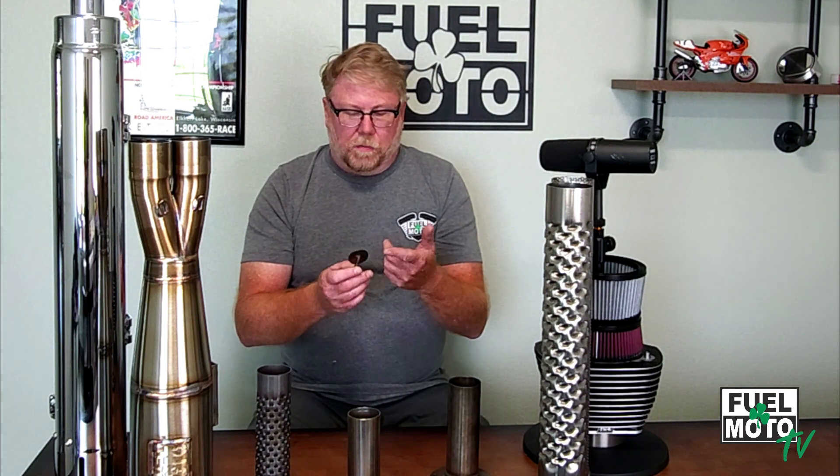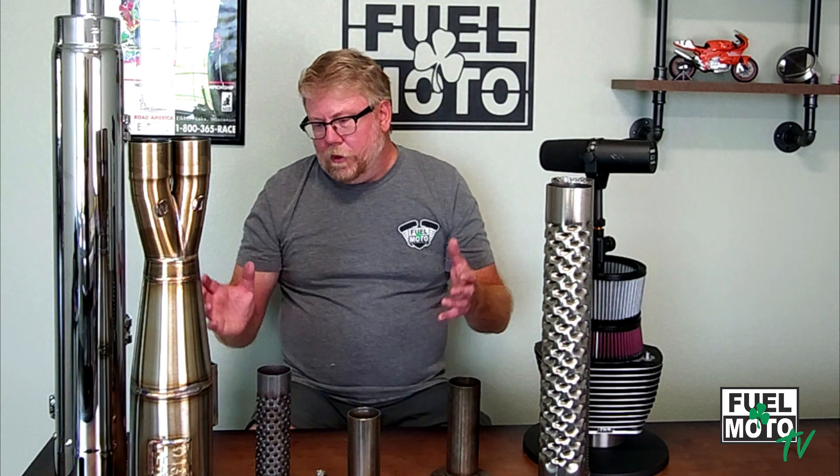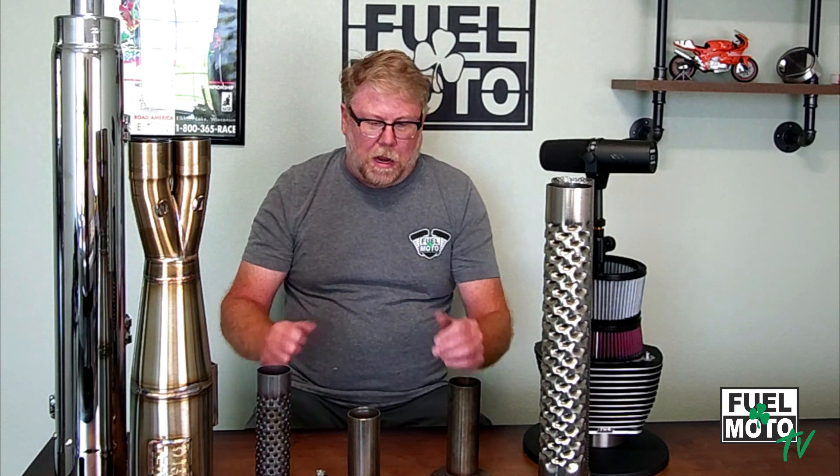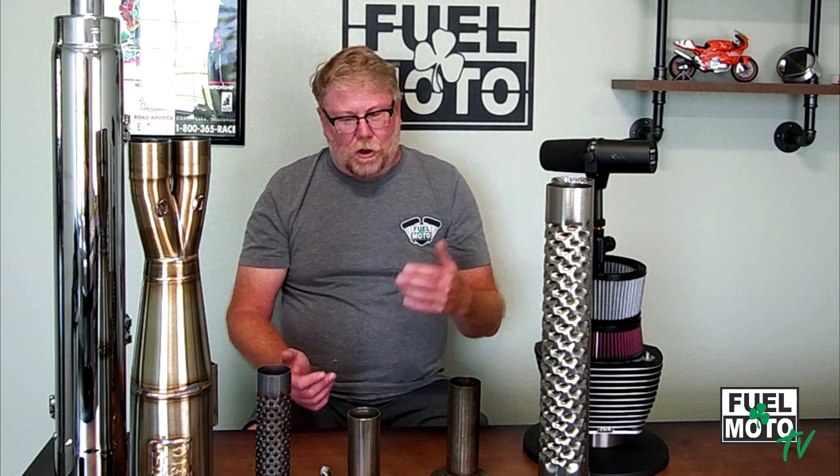You can even make these yourself — on our website we have the sizes of the parts it takes to make these. If you've got a three-inch baffle, you probably want a little bit bigger disc diffuser than our standard inch-and-a-half. Through the different types of baffles and designs, it's really cool that you can make them work well in a lot of applications without having to buy a different exhaust system, replace a muffler, or replace an entire baffle. A lot of times you can make this stuff yourself with pieces and parts. There is no blanket statement on what doesn't work and what does — all you can do is try and test it, which is what we do here on the dyno every day for decades. Thank you very much for tuning in and check us out at FuelMotoUSA.com.